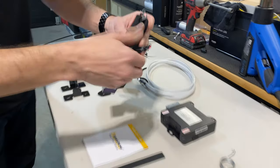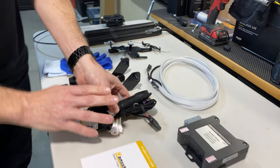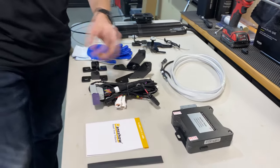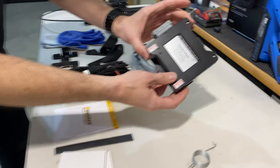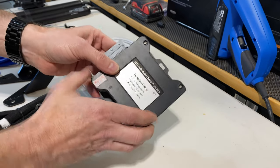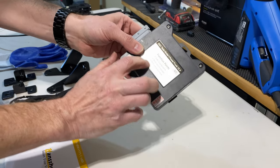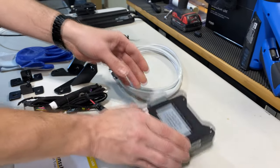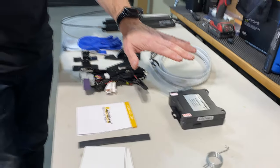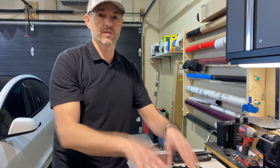This is all of our wiring with a 30 amp fuse. This kit is completely plug and play, specific to this Tesla. This is the control box that's going to make everything happen. This is the version 5.0 and it has a soft closing latch function. It's a waterproof version with an anti-pinch function — a safety mechanism so the frunk lid, if it finds too much resistance, won't fully close and pinch your fingers.